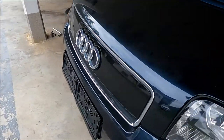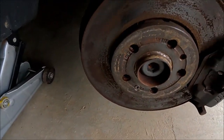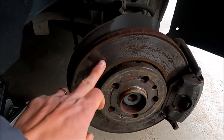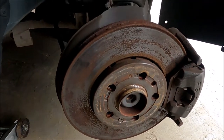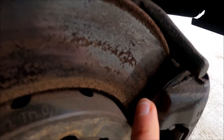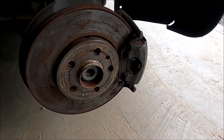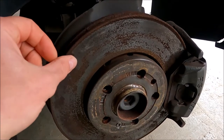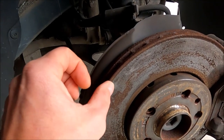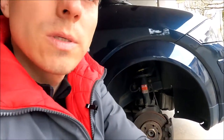I've already taken off the tire, so here you can see the brake disc is basically completely rusted, and this is dangerous to use. You can also see that the brake pads still have a lot of meat on them - they are practically almost new. This is because the brake pads were replaced just before the car was put away.